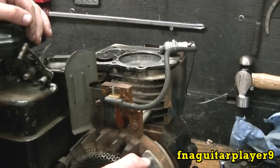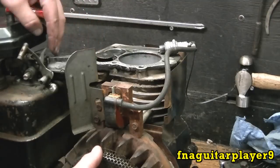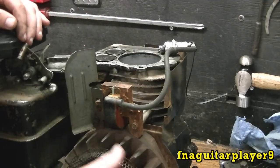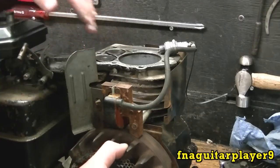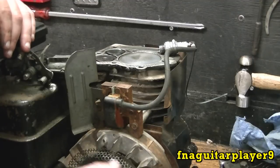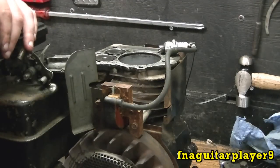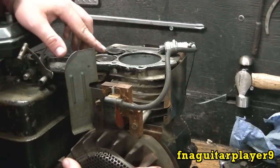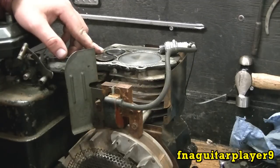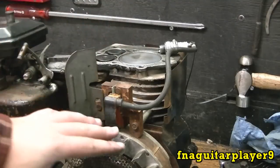The piston is coming down, creating a vacuum, and the intake valve is opening, allowing a mixture of air and fuel into the cylinder. The piston continues down, the intake valve closes, and the piston comes back up on the compression stroke. At top dead center, the spark plug fires, causing an explosion in the cylinder that forces the piston back down. Then the exhaust valve opens and the piston comes up, pushing all the burnt gases out. The cycle just goes on and on while the engine is running.